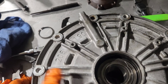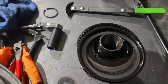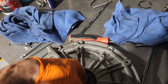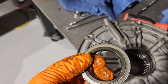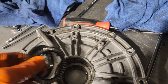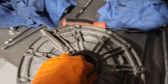Now this ring will come out. There are some washers in behind there that will come out as well. Pull this up off of there so you can see — and there is where your clutches are, your clutch plates. Be very careful to keep these organized; these shims are very important. Some metal has been chewed up in there. As you can see how this all comes out: shim, larger plate, roller, some more shim to allow oiling.